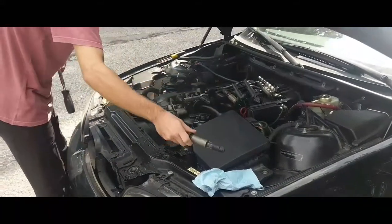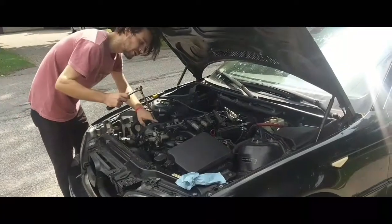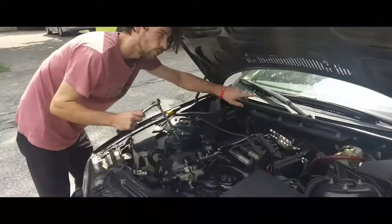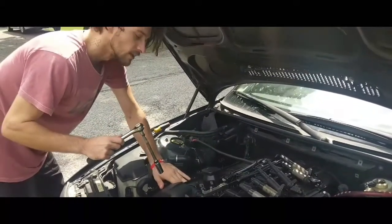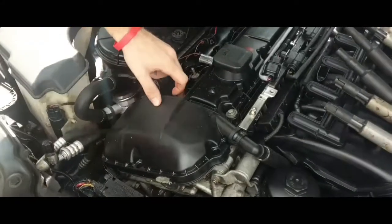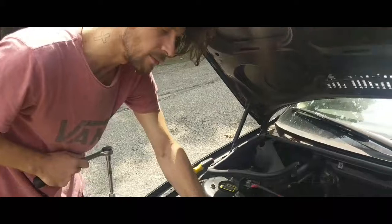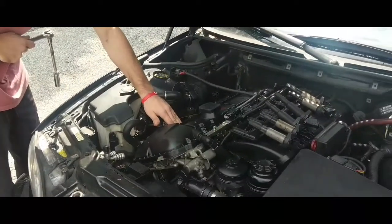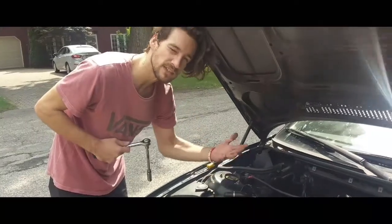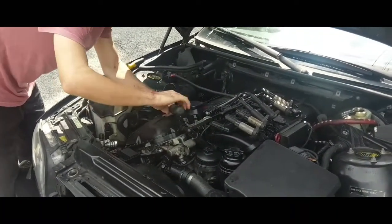We're back here in the morning. Pull the plugs out again and crank it over four or five times with the plugs out. Like I said last night, the upper engine cleaner I put in is really flammable — so if you start it with the plugs in and that spark hits the flammable material, boom. You don't want that to happen. So we're pulling the plugs out before we start it.